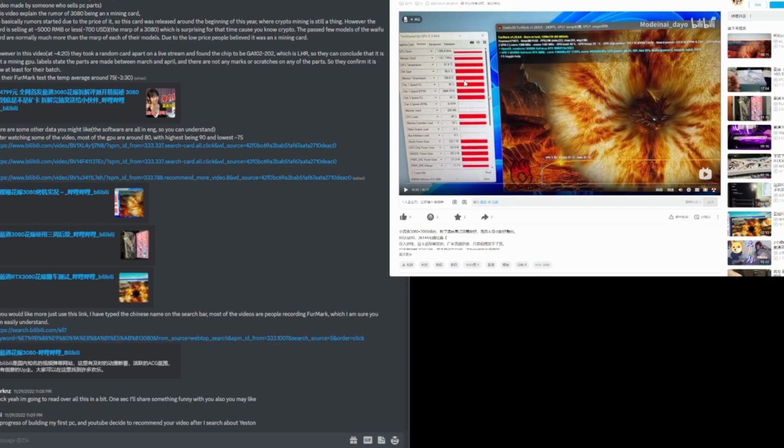You can see right here where someone was doing thermal measurements and their VRAM was hitting a memory temperature of 100C. That is dangerously high. Ask anyone who mines crypto what happened to theirs after a while. They got errors and issues happen, and sure, it can run that high, but it starts doing error correcting. It starts having issues, I believe, if I'm understanding it correctly.